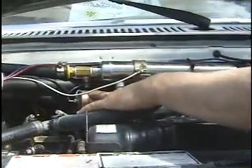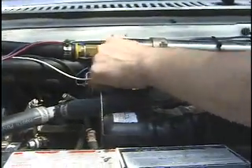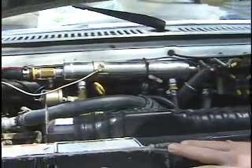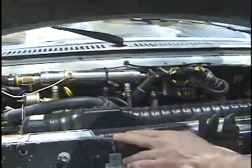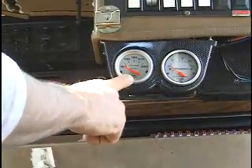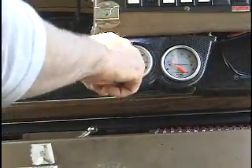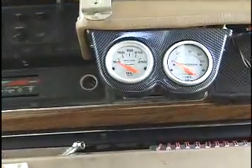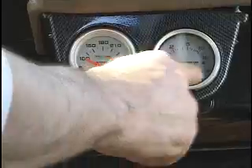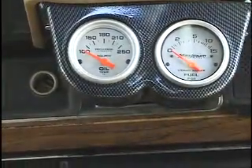Attached to this we have our pressure gauge and temperature gauge, allowing the driver to ensure we are up to proper temperature and that all systems are go on the pump. This temperature gauge will show that our vegetable oil fuel is up to around 200 degrees — the operating temperature of the engine. The pressure gauge tells us our fuel pressure is proper: 15 psi is what the engine wants.